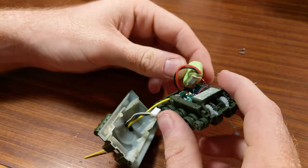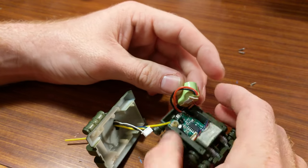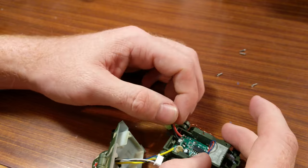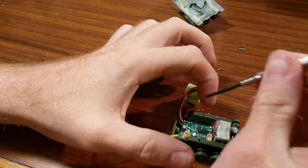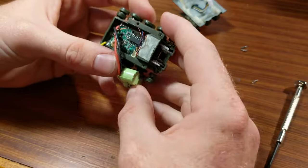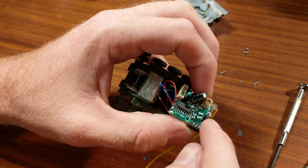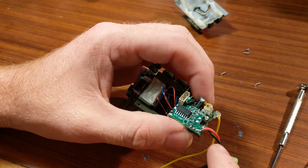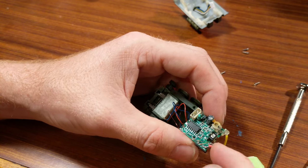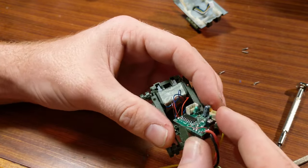We'll go ahead and lift the battery out — it's just held in with some double-sided tape — and you want to be very careful because there is a wire delicately stuck to it, so slow and gentle is the key. There's a screw holding the PCB in; we'll go ahead and remove that and shake it out. Interestingly, the charge port is actually on its own PCB at 90 degrees to the main board. I reckon that's because it was cheaper to make that interim piece of circuit board than to find a charge socket that actually fitted what they wanted to do.